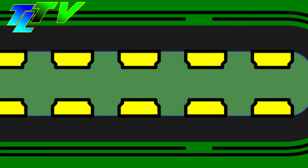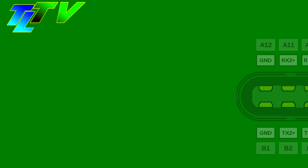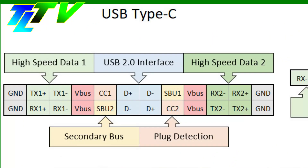More and more mobile phone manufacturers are implementing USB-C Power Delivery, which does not use current modulation or data lanes for communication to the power supply, but rather the dedicated power delivery communication lane of double-ended USB-C cables.